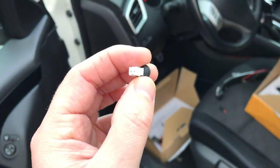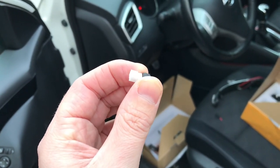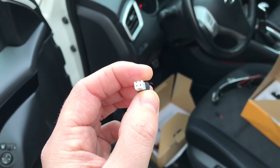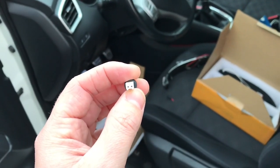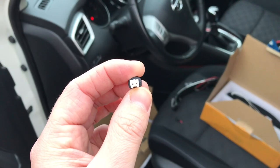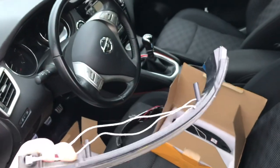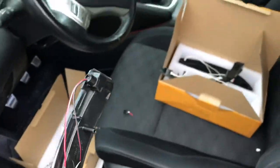Another thing — I helped the Jugen store on AliExpress to fabricate the male version of this connector. But I lost one of these, and that was quite a problem, because afterwards I wasn't able to reinstall my original lights on the car. So I had to be a little creative myself. It happens that I still had some IKEA LED cables lying around, and I modified the 4-pin connector to a 2-pin connector like this one — it looks quite alike. So I have some new connectors and I will test them right now. If it works, I will insulate this part with some silicone, as they did on the dynamic version, and then they are good to go.